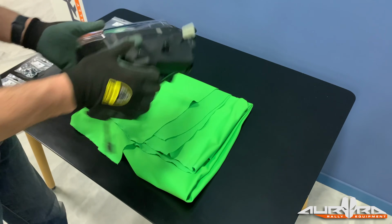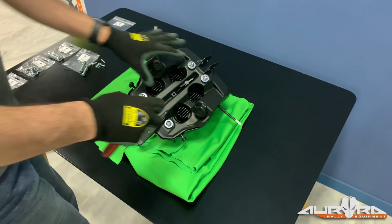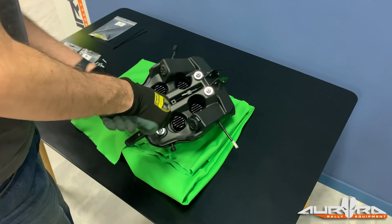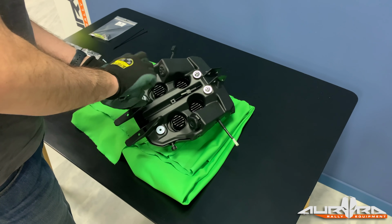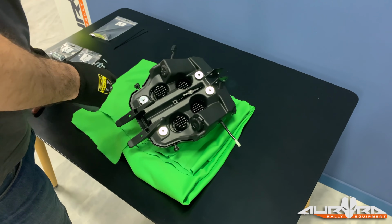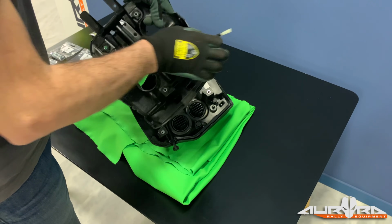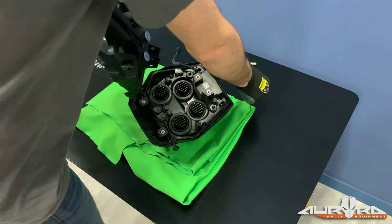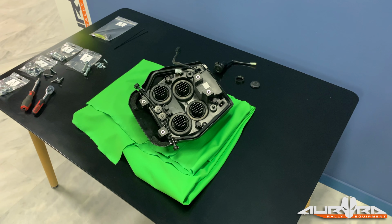Place the headlight on a soft surface. This will ensure the plastic screen is not scratched. Remove the 4 bolts that secure the headlight cover. These bolts will be used to mount the speedo bracket on the navigation backplate. Remove the 12V socket from the headlight support. Remove the round rubber cover from the other side of the headlight support.